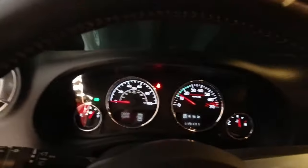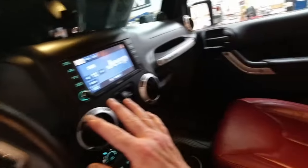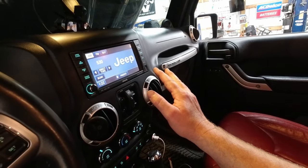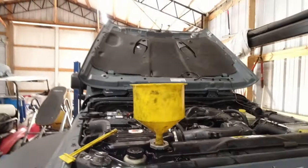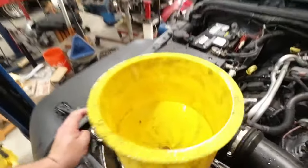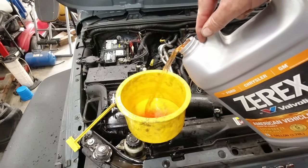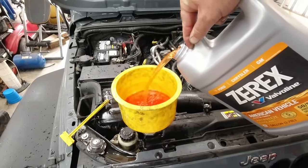If it's being stubborn, I'll get in here and give it a little throttle, bring the RPMs up off idle. We're starting to build some heat in the vents now. What happens sometimes when you rev them up, they'll volcano out — and you can see it just volcanoed out and spilled. It probably popped an air pocket. So we'll add some coolant back to it. I was starting to get heat in the vent, I let off the throttle, and it spewed back up. Big mess to clean up, but that's just part of it.